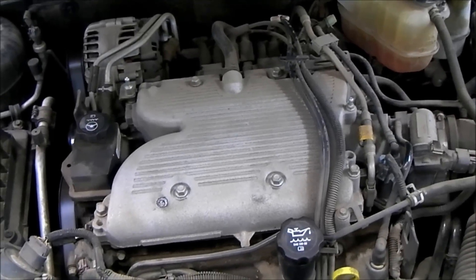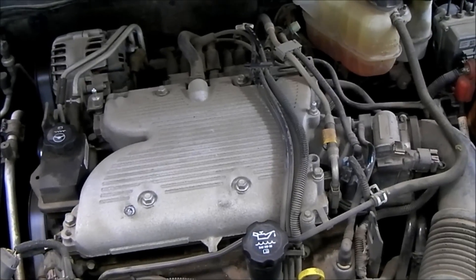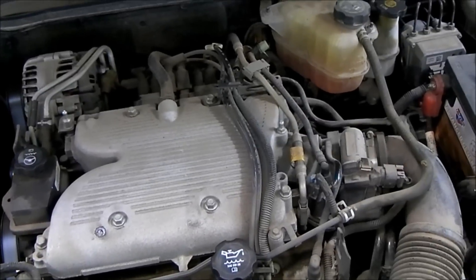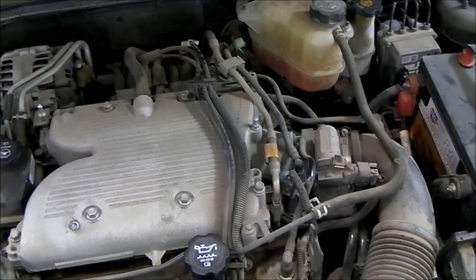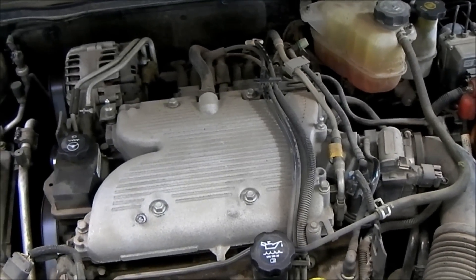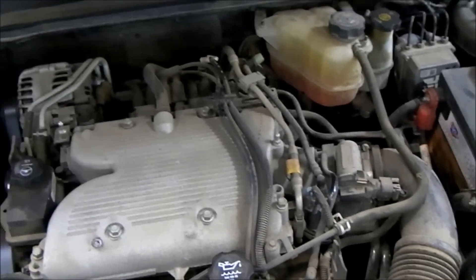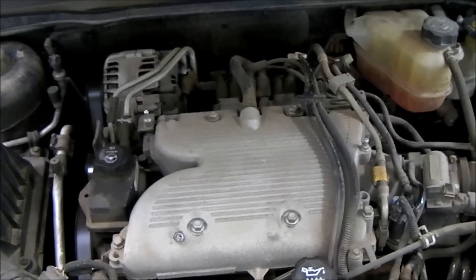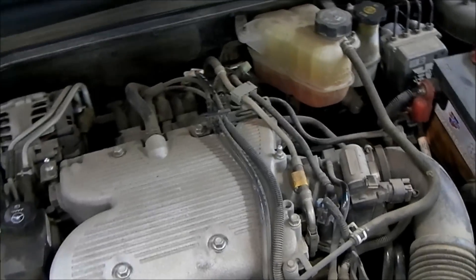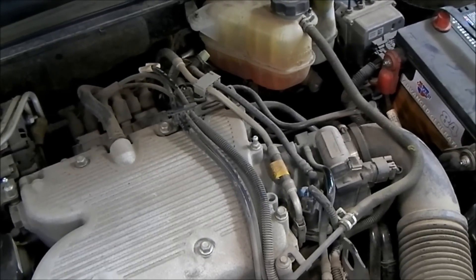Right now I'm going to show you how to do a voltage drop test on the charging system. Voltage drop testing is pretty important because quite often you might have a charging system problem where the car runs and draws the battery dead, and instead of the alternator being bad, the problem is actually a bad connection either at the battery or at the alternator or some bad wiring. Voltage drop testing the charging system is so easy to do that it should be done prior to replacing any alternator.